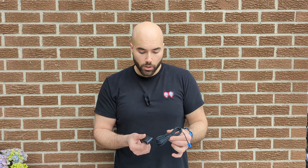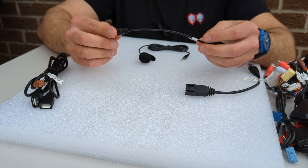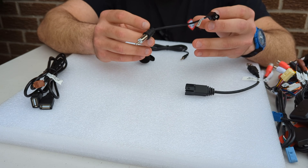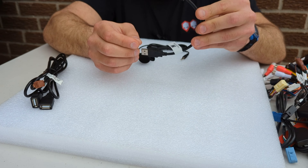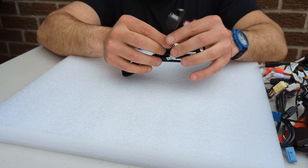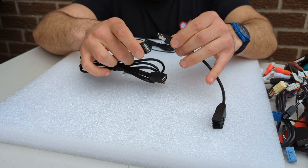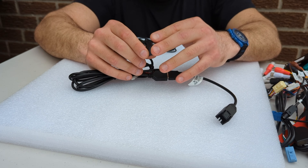The next thing you'll notice is the SIM card tray, which tags along with your LTE antennas. Then you have your GPS antenna — you can stick this GPS antenna anywhere really, there's no particular place to install it. However, we do recommend not installing it on any metal surface as it can sometimes interfere with the signal. The great thing is you don't need to use our GPS antenna — they sell on Amazon for about $6 USD a GPS extension cord, male to female, which lets you retain your original GPS antenna mounted on your roof. If you're in a rural area and not getting good signal with the antenna tucked inside the dash, get yourself that extension cord.